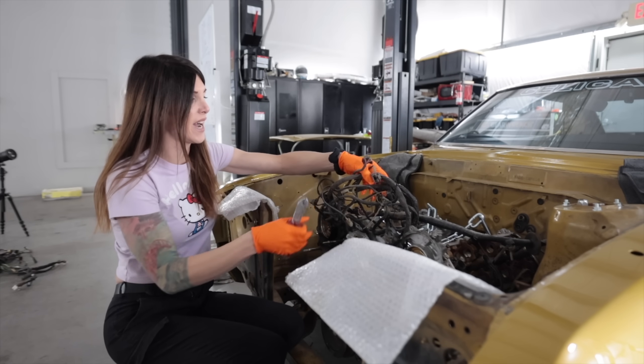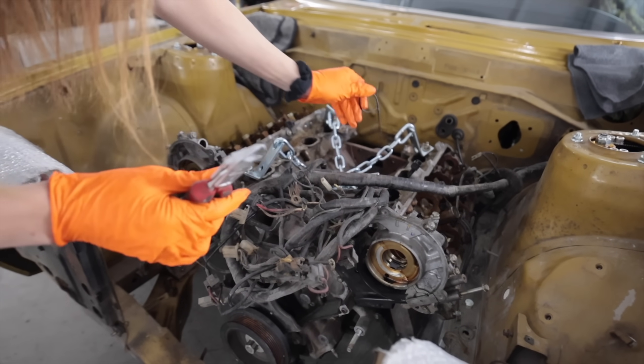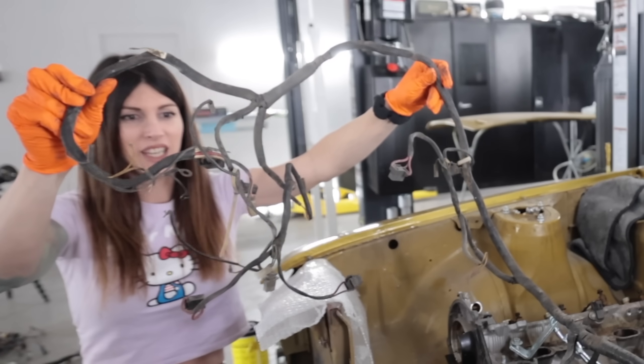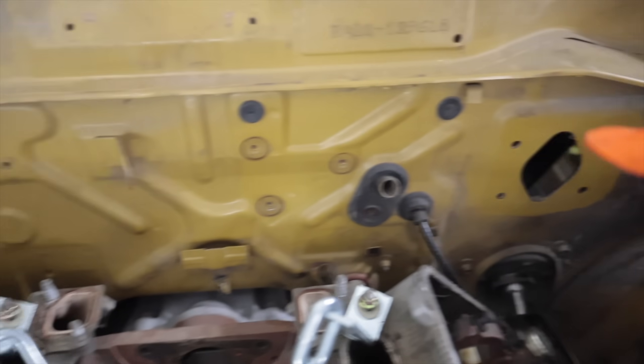It really doesn't matter because I'm not using the stock Tundra ECU. I'm essentially just doing this so I have factory Toyota plugs and factory Toyota wiring. This right here is all the wiring there was to the 18R that came out of this car — it's a super tiny harness, but it comes out of the firewall, and the opposite side is the Tundra.